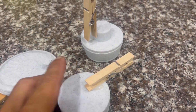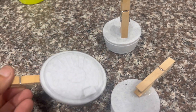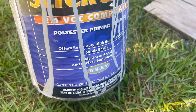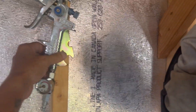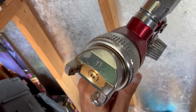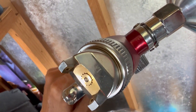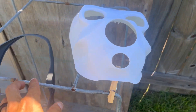Prepping these pieces, there is no sanding, but I did do a little trick with some clothespins — I hot glue those onto the inside of the filters and earpieces just to help me mount them, which will help me spray and handle them when they are drying and curing. We're going to be using Slick Sand, which is a sprayable body filler primer, and we need a special HVLP gun. Something with a nozzle of two millimeters or higher is going to be better.